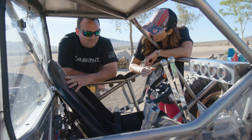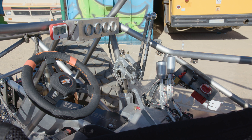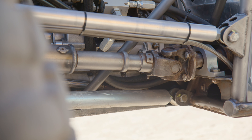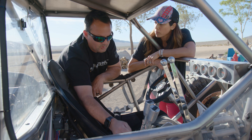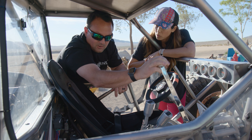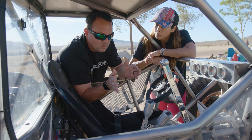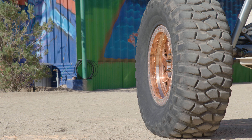This little spaceship has a lot going on — this is not just get in a car and steer it. Let's first talk about the Atlas transfer case. It allows you to engage the rear, engage the front, or engage them both at the same time in both high and low range. When you're on a rock crawling course and competing, you want to be able to disengage the front or rear. You can pull cutting brakes, locking the rear — what they call a burn, or front dig — to get in a better spot. You have lockers front and rear, air controlled.